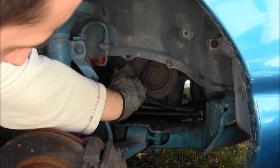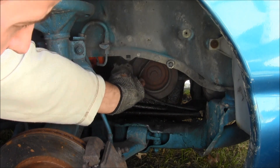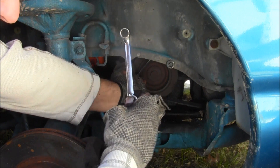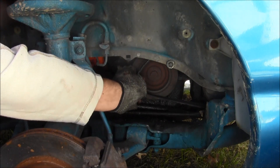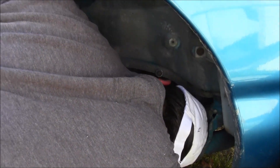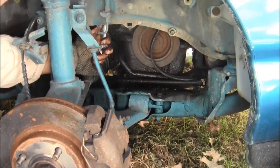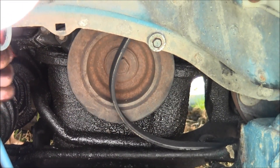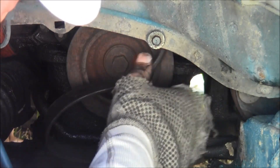This is how much room you've got to work with - this part's got to go over here so the belt's got to go underneath here. I have it all routed. Now I need to go up in there, loosen the tension bolt and it'll give me enough play to get in there. There it's loosened.